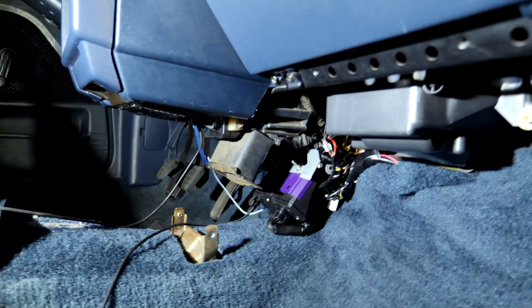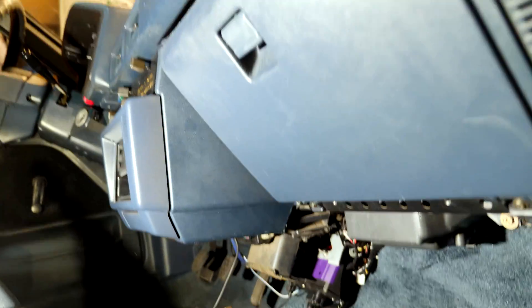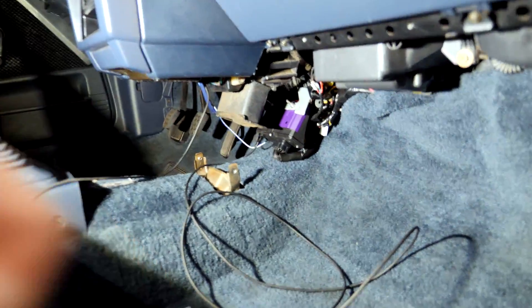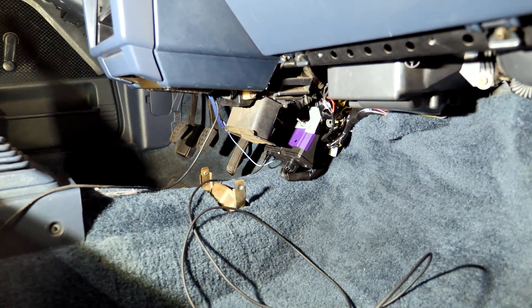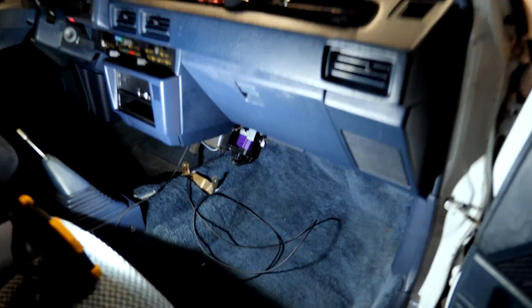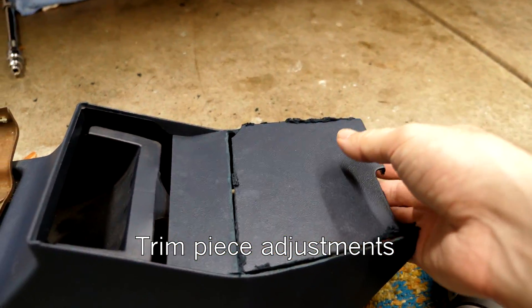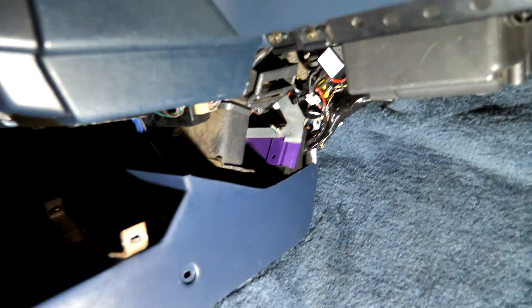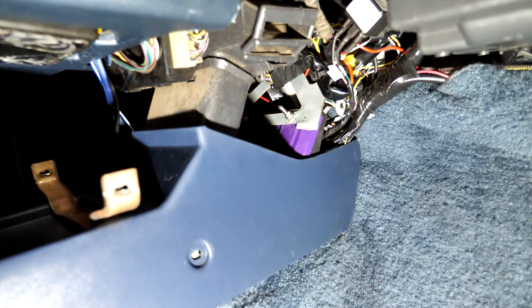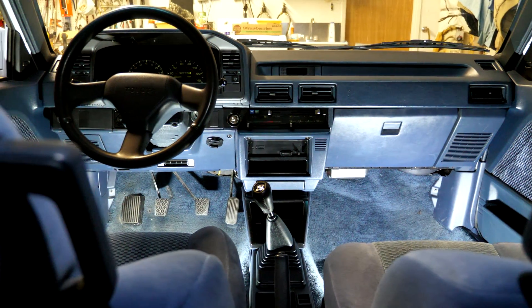I'm on the finishing straight now. I got all the wires tucked away and they look really good. I have the USB cable so I can connect it to the computer, planning on running it down and popping it out through the glove box so if I ever need to tune it I can do it without taking the whole dash apart. The ECU is sitting nice and firm — absolutely fantastic, no jiggling, no wiggling. I fired up the car, all sensors are working, there are no pinches or breaks in those wires, and I got the air filter and the trumpets back in. The ECU is installed, the wiring is all cleaned up and it looks fantastic.